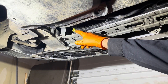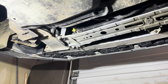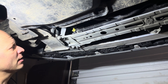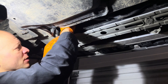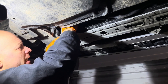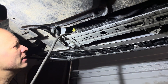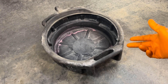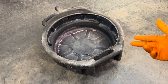The coolant drain plug is located right here on the left side of the radiator. Install a piece of a 5/16-inch or 8-millimeter inside-diameter hose on the drain plug, then place a suitable drain container underneath the vehicle. I use a drain pan like this — check the links below the video for all the tools and supplies you may need to do this job.